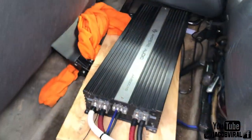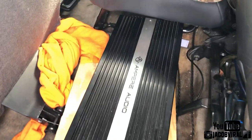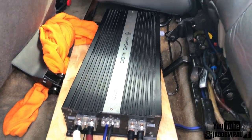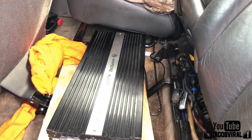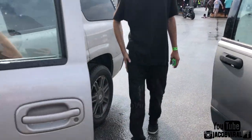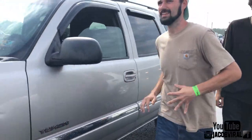There it is. Okay. That's the most important part of this. And it's at 2 ohm. Yeah. So you didn't want to do half ohm because you don't have the electrical, 2 ohm for efficiency. Yeah. So you upgrade later. Yeah. Gotcha. See, you got it. I understand. I had 215s and then 415s and then 418s, and I've been through a lot of them.